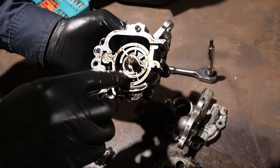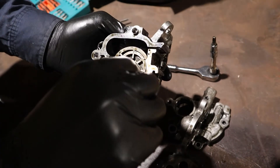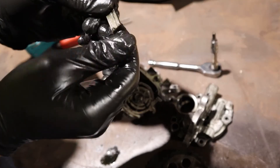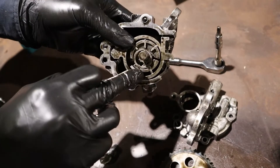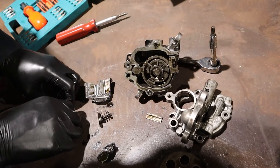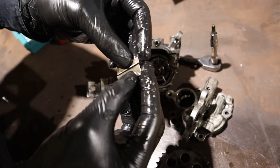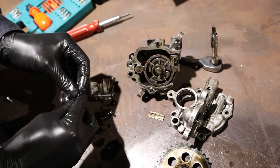As I take the cover off, you can see it's broken inside. Pull out one of the vanes — you'll usually see a deep wear mark on the inside of the vane where it sits against the inner rotor. You can see there was one missing; we found that missing vane in the pickup. What happens is the vanes wear on the inside, and eventually once worn enough they split, jam the pump, and break it.